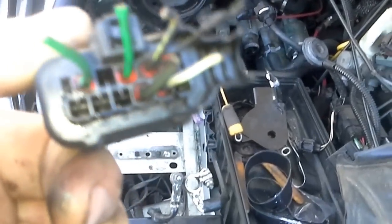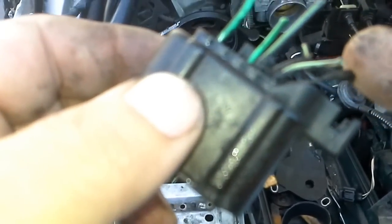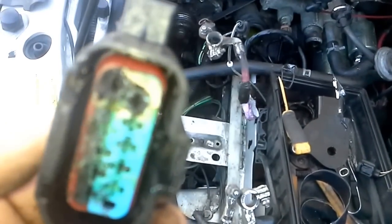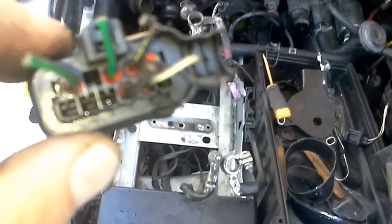Except there's a new twist — this got so hot. You see this wire right here? It's supposed to be white with a tan stripe. It's actually gotten so hot that the casing of the wire has melted off. Let me tell you how I fixed this. The part costs $78 new; however, I went to the local pick-a-part and pulled one off a Mercury Cougar for $2.26. Just splice the six wires together — no problem.